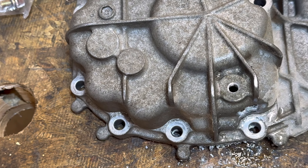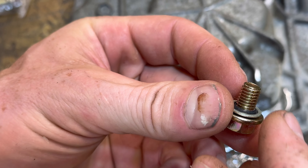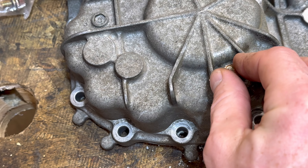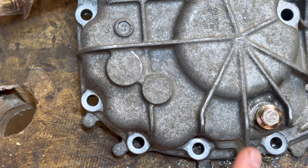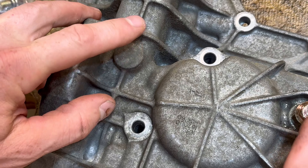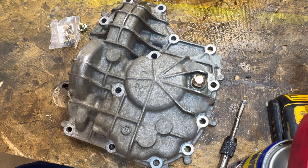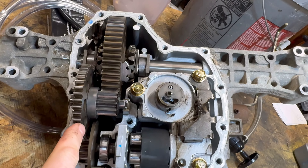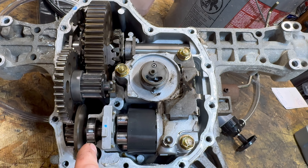Let's see how my tap job did. It's going in there like butter. The drain plug has a little rubber grommet on it, so it is actually meant to seal out fluids. The other one is going to be right there. The reason you need two holes is that when you look at the transmission, they have two different compartments that are somewhat sealed from each other — your gears over here, like your differential, and then your hydrostatic gear pump. There's going to be some gasket material between them.